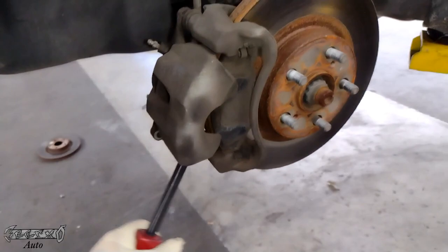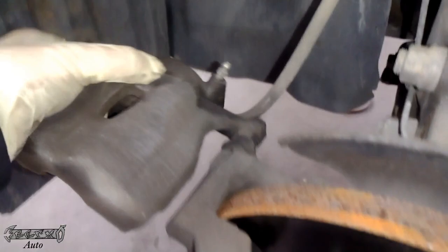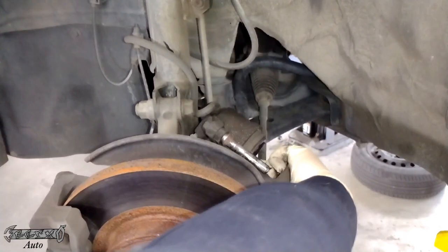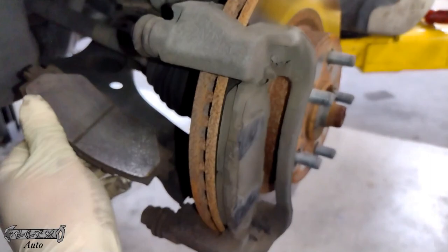Set that aside, don't lose it. Then we're going to try to lift this up - it's probably going to be stubborn because these cars are getting older by now. Use a little pry bar to pry it up, then slide straight backwards. Sometimes this boot wants to stick on here, just take your fingers and pull it down. It's got some buildup of corrosion. Once we slide this out, I'm going to gently set it over the steering knuckle like that to support the brake line and keep the caliper out of the way.